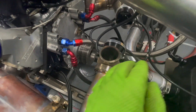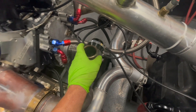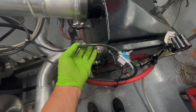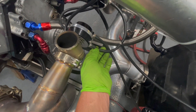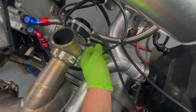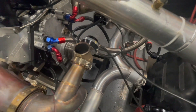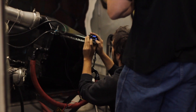What was happening is boost was only being controlled by one wastegate, kind of overworking the other turbo. More importantly, it gave us no boost control because the boost controller was doing its duty cycle thing but was actually getting no pressure - since this was a dead end right here, the boost controller wasn't doing anything. So even when we hooked up a manual controller it's like, what's going on? Where's the leak? And it was actually Diego who identified the problem with the wastegate.